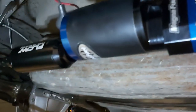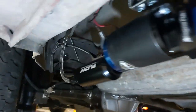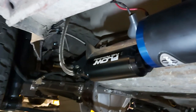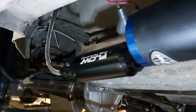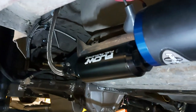MagnaFuel 4303 pump — they say this thing is good for a thousand horsepower, so we'll see. We've got number 10 going in. Everybody says you should go number 8 out, but the bottleneck in the system I'm using is the actual fuel feed inlet. When I measured it with the vernier it's only 250 — a quarter inch — in ID.